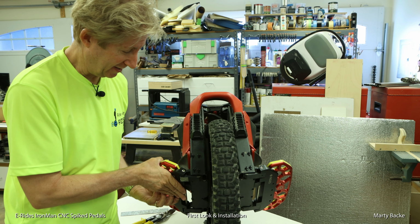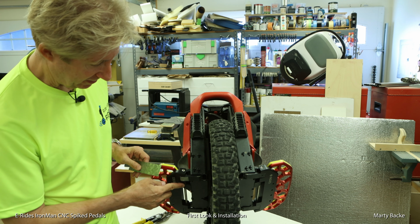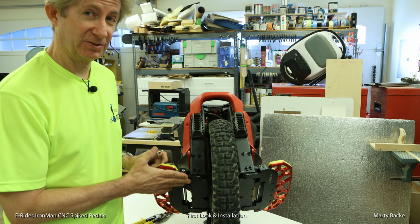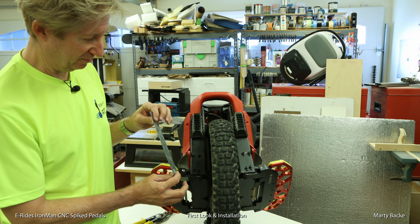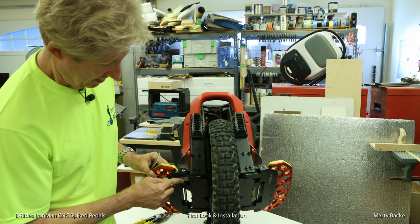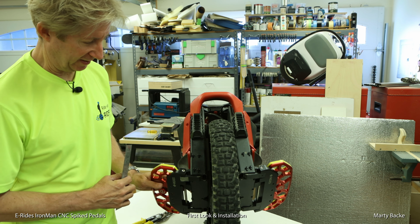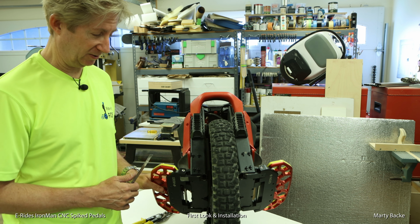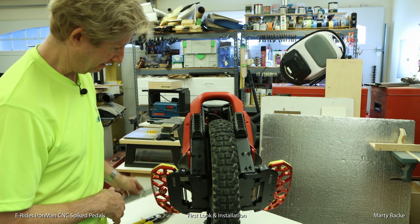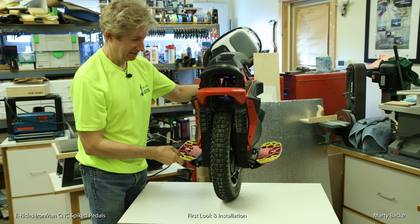Pretty easy to add some additional angle, and you can double these up or add three layers. It works amazingly well. Now, this piece of galvanized sheet metal adds about 3 degrees additional dihedral angle, just to give you a feel for what you can do. Add two of these and you'll probably get about 6 degrees. Problem solved.